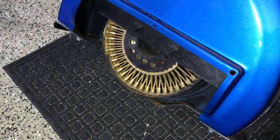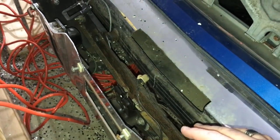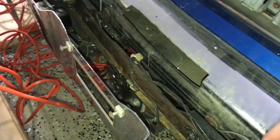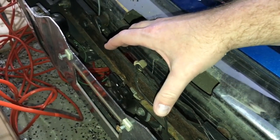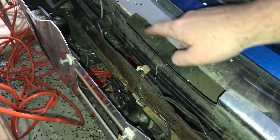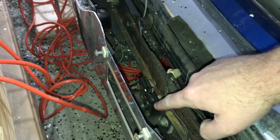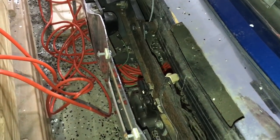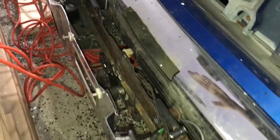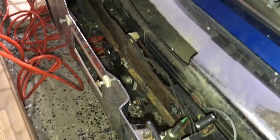Here's the bottom bucket — it looks a bit rough since the car's been sitting a while. I had cut this section so the rim could fit with enough room to close. I also had to make a hole in the bumper itself so the continental kit could close, and I relocated the bracket here. That didn't work out too well, so it was something I was planning on redoing. As far as the side profile, it's already cut for our Caprice so it fits nicely.